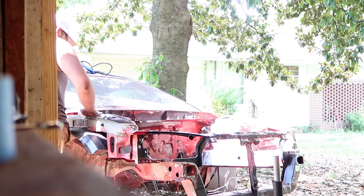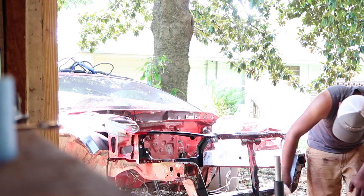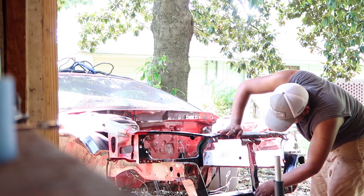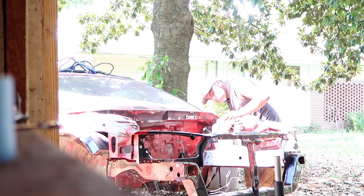Hey, you guys, it's getting a little bit late, so before I leave I want to at least give it one coat of primer. I'm fixing to clean it with some thinner. It's getting darker and it's fixing to rain, so I better relay some primer on this bare metal before it gets all rusty by tomorrow. I already cleaned the front side with thinner — I just need to clean the firewall with thinner, tape all those lines, and hurry up and paint it before it rains.